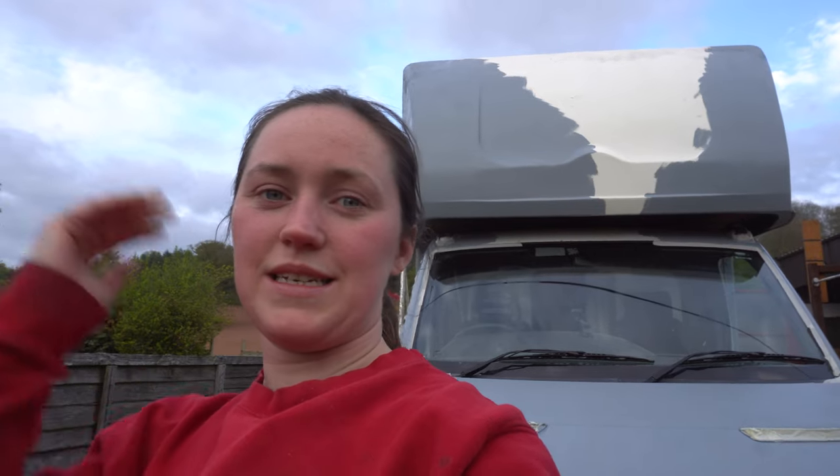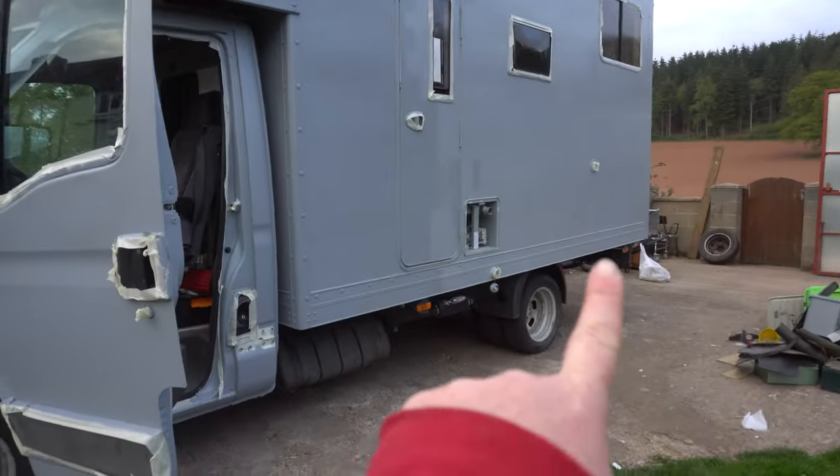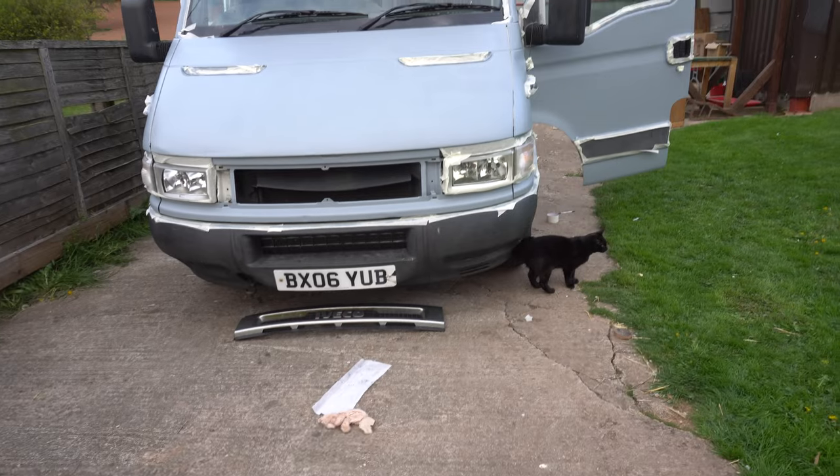Realisation so far: it's taking far longer than I thought, but it's actually using a lot less paint. If you're doing a normal van, I'd say two and a half litres is probably enough for two coats, especially when you're adding four parts paint, one part thinner. I've used about a litre and a quarter so far on the back, one complete side, nearly all of the front, and a little bit of the next side. I'm also painting the pieces we intend to paint black — like the lower skirt area — grey first, just in case we decide differently.